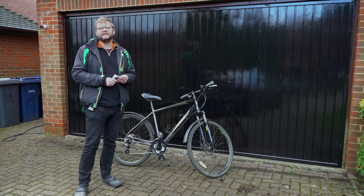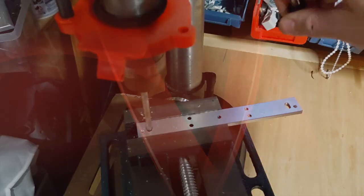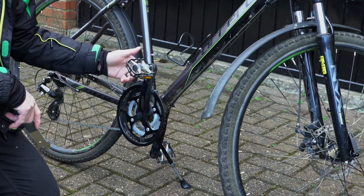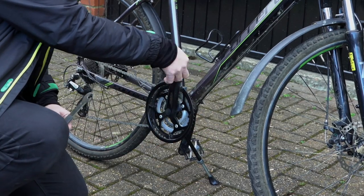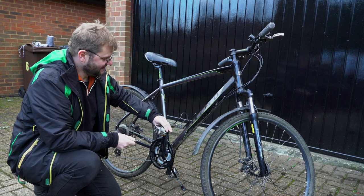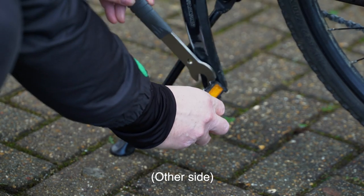The first thing I'm going to do is remove my pedals, as the new kit comes with new pedal arms. To do that there's a special tool — I'll put a link in the description — it makes it a lot easier. This one has come off particularly easily, I can do it by hand now. What I would say is that on the other side the thread is reversed, which is confusing, but that side came off very easily too, which is encouraging.